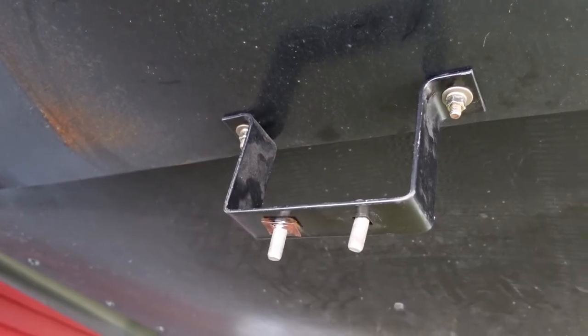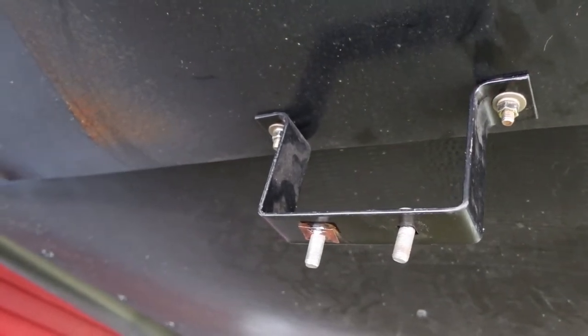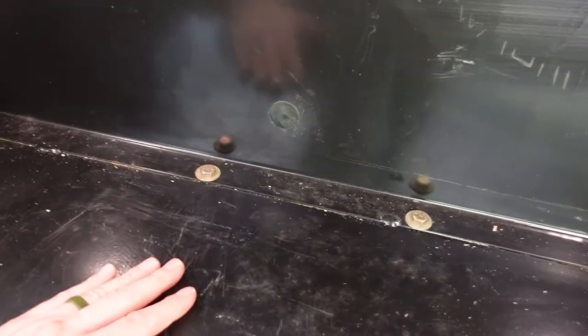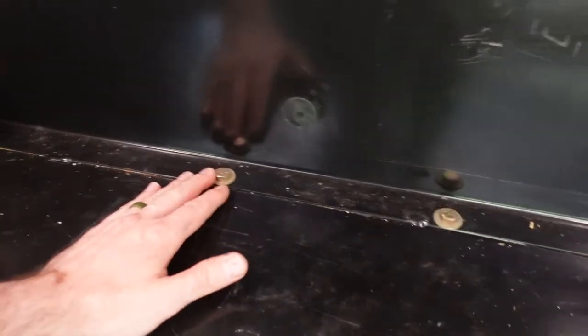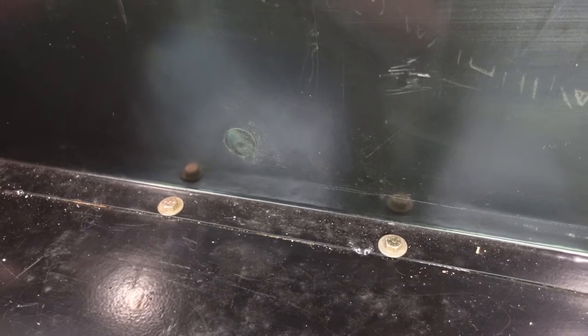Here's what it looks like with the spare tire unmounted. It's basically just a U-bracket with some flanges mounted up to the underside of this storage. It's got two bolts that connect to the lags on the spare tire. Inside the storage compartment you can see there are only two bolts and two washers — those are the only parts I actually had to buy. I did use grade 8 bolts and washers just to have something real strong that I wouldn't have to be concerned about shearing off with the weight of the spare tire hanging underneath.